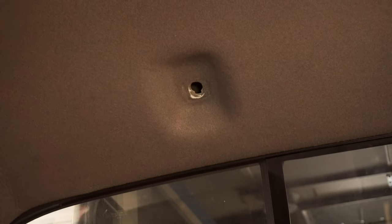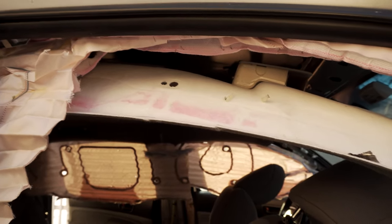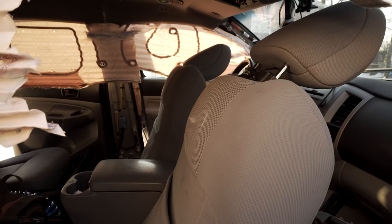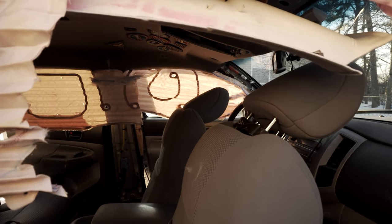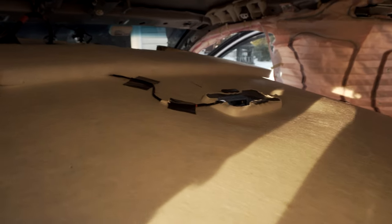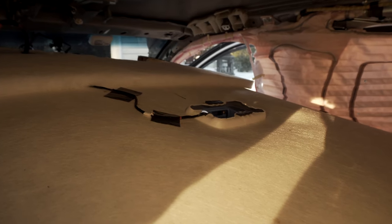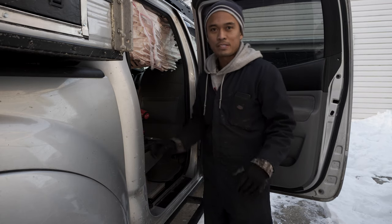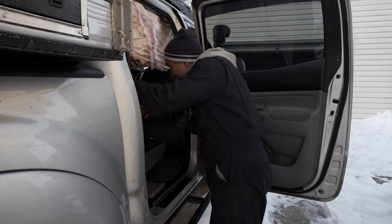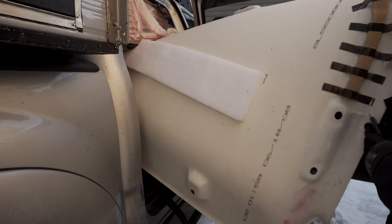The whole headliner is free at this point but we don't want to pull it out yet — we have to remove the wires that power the dome light. I moved both seats as far forward as possible and now we'll slowly push down on the headliner. I pulled it down slightly and you can see wires running across the top for the dome light, so I'll peel up the tape and remove that wire. I ended up folding the headliner in half and forward in order to pull it out without damaging it too much.